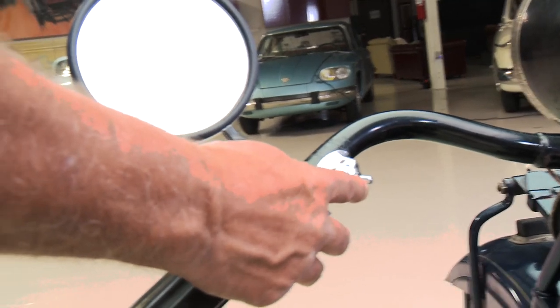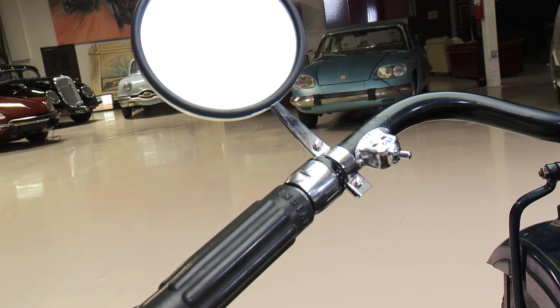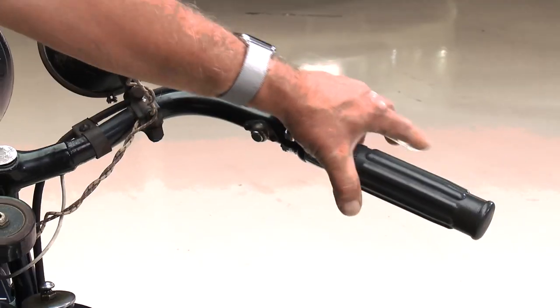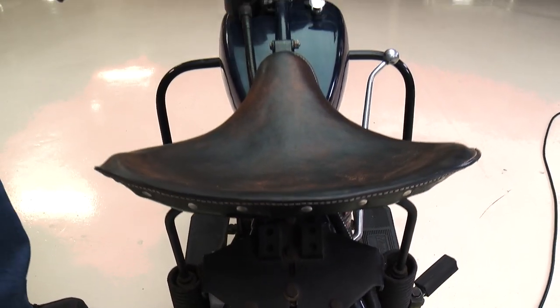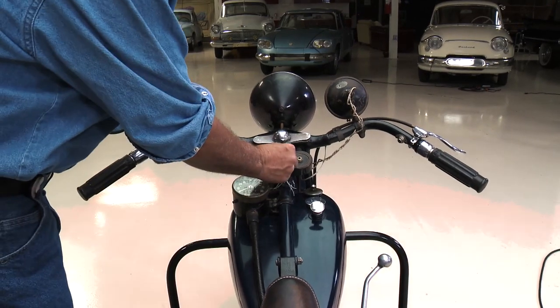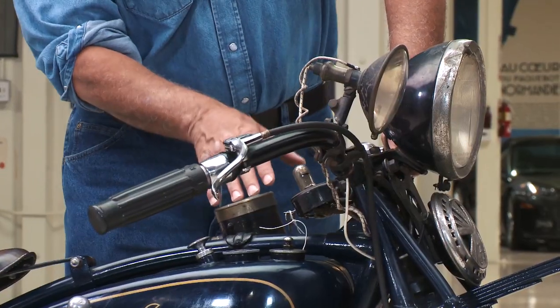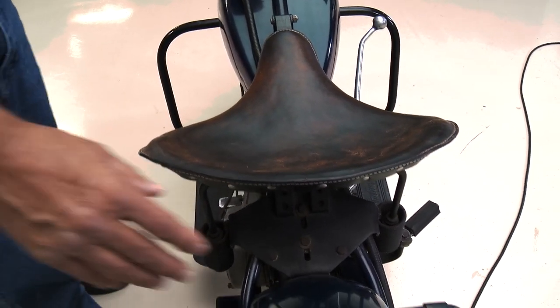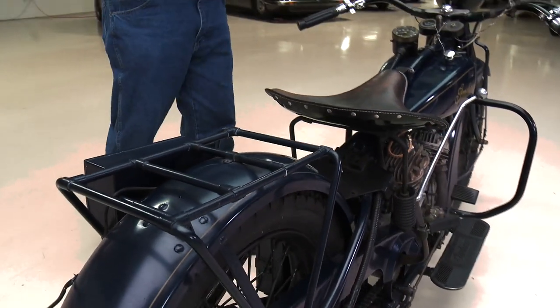Normally this would be a high-low beam. I just converted it to an on-off kill switch, because you're really on high beam — you're not going to blind anybody with these lights. This is your advance and retard on your ignition. This is your hand throttle here. This is your front brake. The 101 Scout probably had the best front brake of any Indian, at least up to that point. You can actually stop with the front brake, which was unusual because most motorcycles you couldn't. You've got a little light here that lights up your speedometer so you can see at night. Really comfortable saddle. You've got a luggage rack back here, a little tool chest — you can carry extra plugs and things like that.